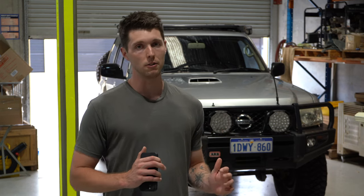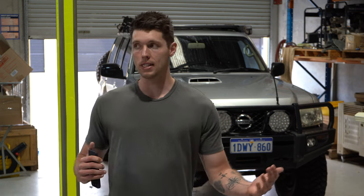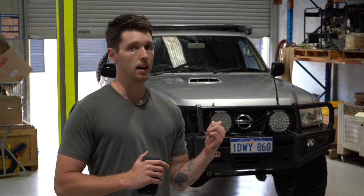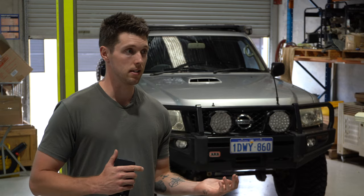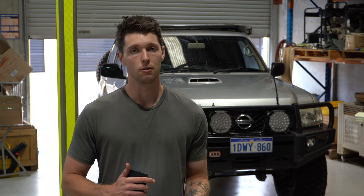I think I found myself a little bit of a solution to this, and that is a T-Lex and needle valve. What I'm going to be doing today is installing the T-Lex and needle valve. I've already driven the car and recorded what my EGTs are prior to the installation. Then I'm going to drive the car after the installation and see what my EGTs are, and also what the T-Lex and needle valve will do to the overall performance of the vehicle.